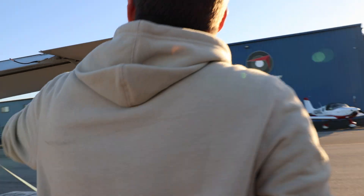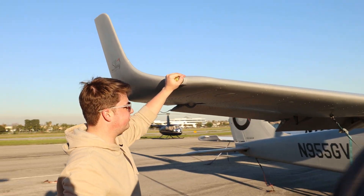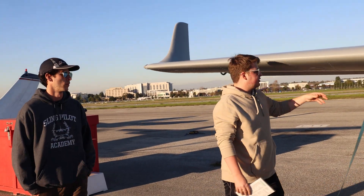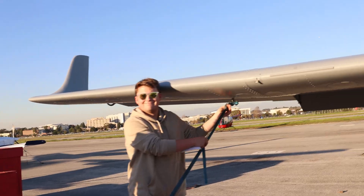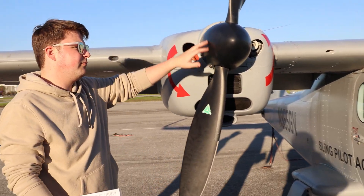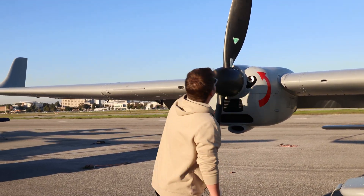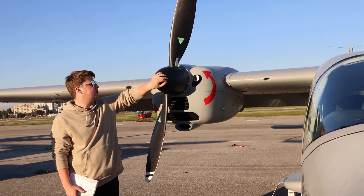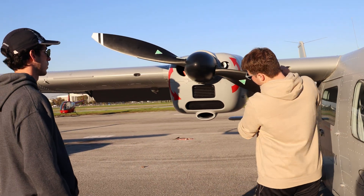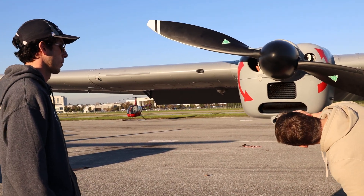We'll move on and check our little winglet. Again, coming back to the leading edge, we're looking for any damage. We're going to check our light here and make sure it's nice and secure. While we're walking along here, we can go ahead and take this tie-down off. Checking our leading edge — seeing no dents, nothing that looks too concerning. Some air intakes. Coming back to the right engine, just like we did on the left side, we're going to check the condition of both props. They both look great — no chips, nice and new — and our prop spinner is fully attached. We'll also check our radiators: oil radiator looks nice and clean, same with the coolant, and the air intake is clear with nothing blocking it.